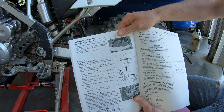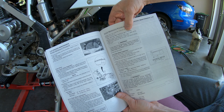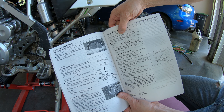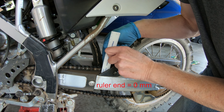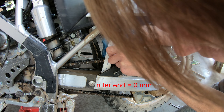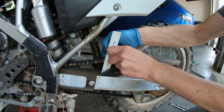For the torque on the axle nut it's 58 foot pounds or 79 Newton meters. We put the ruler on the swing arm at the base of the slider and lift up — we've got about 47 millimeters, so we're over the spec.